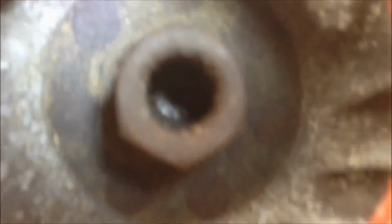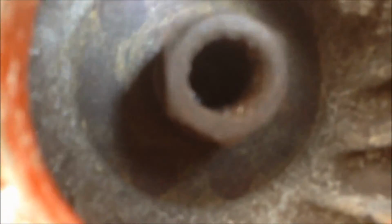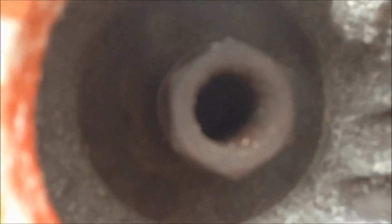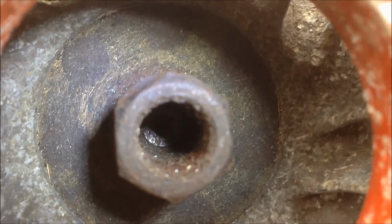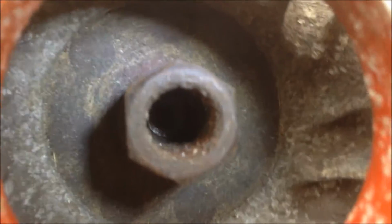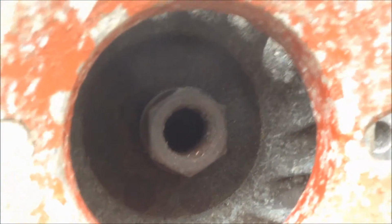If we get a look in, I can see that it's pretty much bang on where it should be. You can see it, maybe. Yeah, there you go. Bang on about 7 o'clock. Maybe a little bit late, but I'm gonna knock it up for now because I'm quite happy with that. It's running okay.